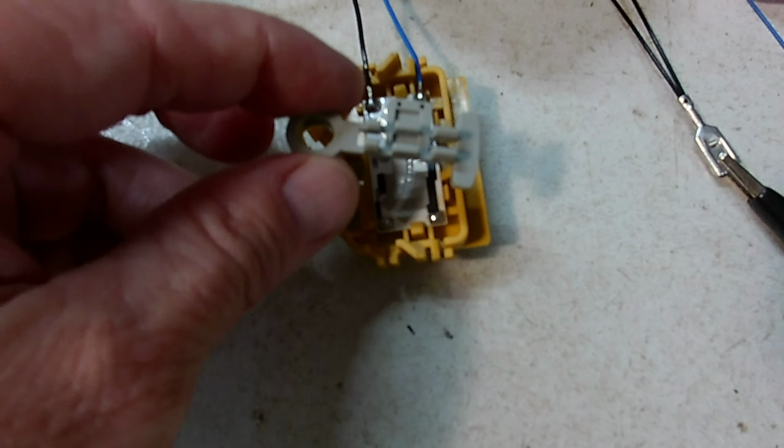It's for a Nissan Pathfinder Xterra something, and it was $12.95 shipped. Not the cheapest one is $60 on Rock Auto. And these grooves are different. And that little tiny thing, I think, is the release in the center. But the ohms did read correctly, like 2 ohms to 85 ohms. So it should be somewhat correct and not reading the P0463.